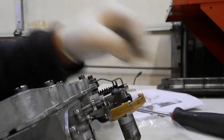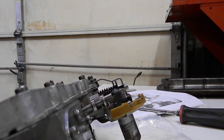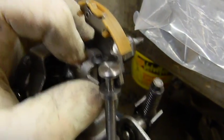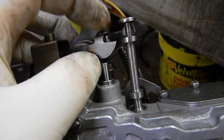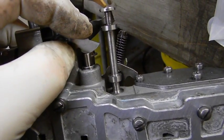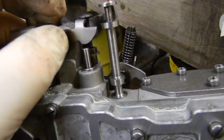I see a slight bit of movement there — by the time I tighten the jam nut it always pulls it a little looser. Where my thumb is, there's the jam nut; here's the screw head that prevents this from going further out, and there's the clearance we need — an eighth of an inch. I had to tighten that screw down to take away a little clearance. When you put this back on your car it'll push this thing further in normal driving, so it shifts a little later and firmer. Tightening the jam nut now.